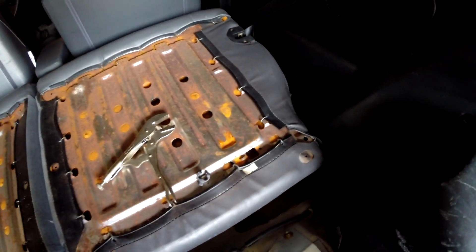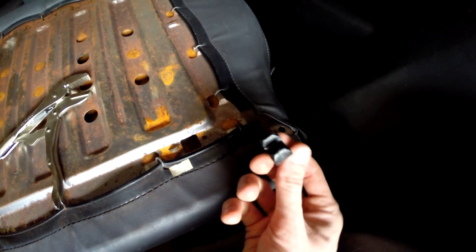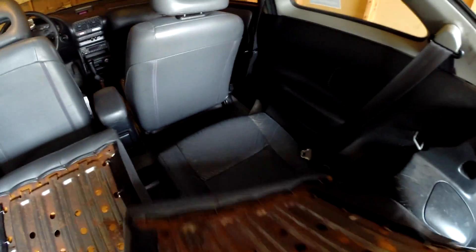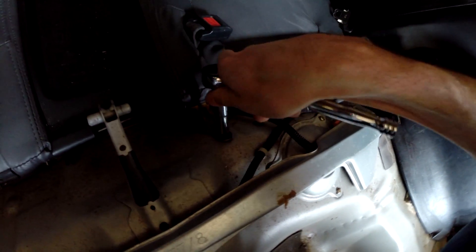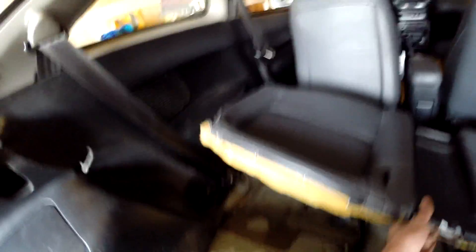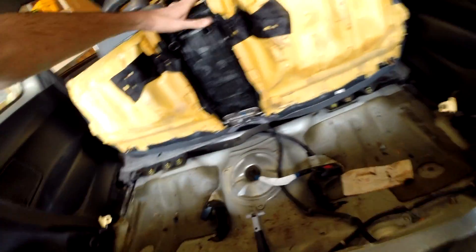Now we can go ahead and remove our rear seats. The first thing you're going to want to do is remove the spacer put in right here — it's basically holding the chair in from moving around. You can just grab onto it and pull it out. Once you've got that spacer removed, it's as simple as shifting the chair over and then lifting up, and then you can pull that right out. Holding the bottom cushions in, you've got a single 10 millimeter bolt, so we're just going to undo that. Then it's just a matter of pulling out the seat — pop it out on the left side, pop it out on the right side, and then you've got your seat removed.